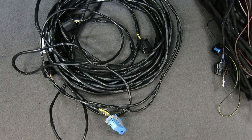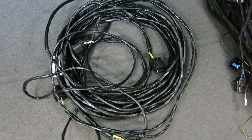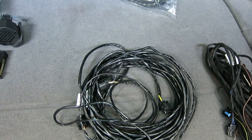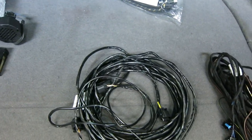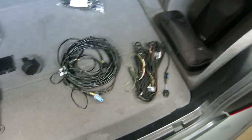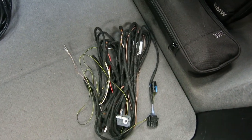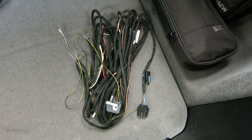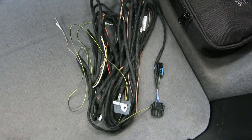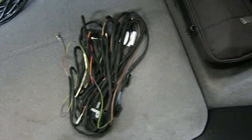Let's start with the front cable harness. This is going to need to start at your front bumper and end up here, so that's quite a task — you're going to have to run that through the firewall from the front bumper through the car and get it back here. The main power cable harness will be run from the trunk, connected to the PDC module. BMW still sells all these parts — as of me making this video, this was about $40 from them.